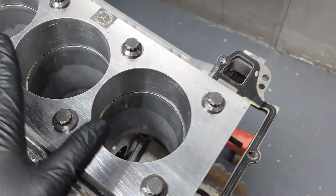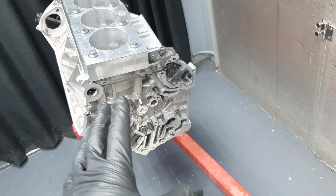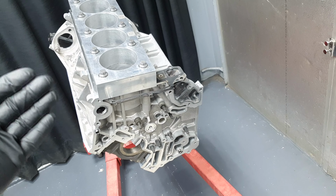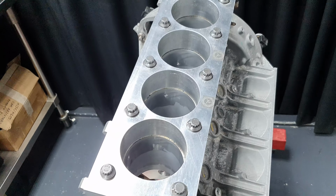What was suffering this engine? There was a misfire and the timing chain was being stretched. There was a fault with the timing chain, with the timing, all right, because it was stretched. It was at more than 5 degrees, and there was some misfire.